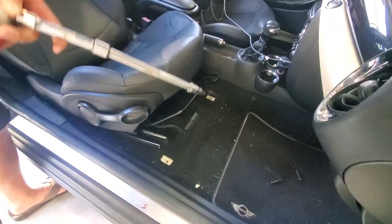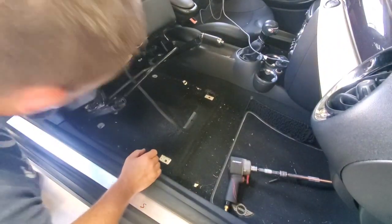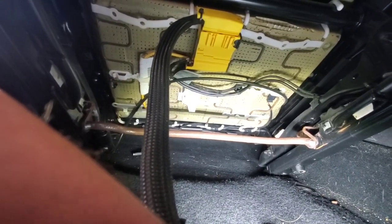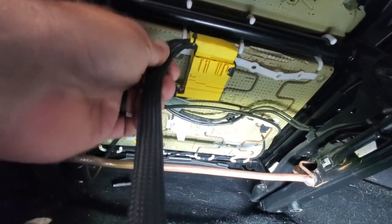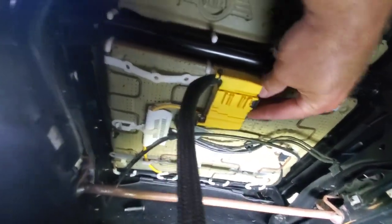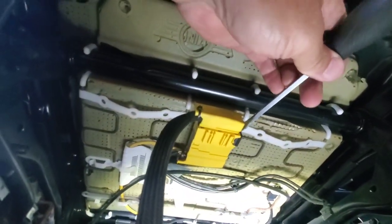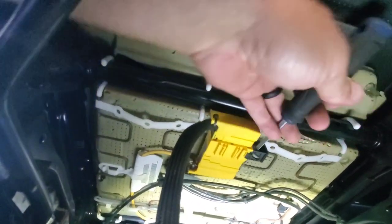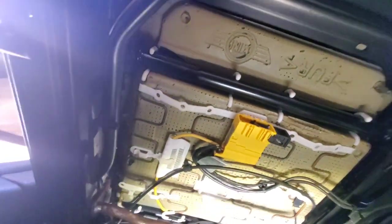Then I'm going to lay the seat back and look for the wiring. This is going to be difficult to film but I'm going to try to show you how to get the seat out. Basically just disconnect this one wire here and this yellow plug. This black fitting here will pull out with a flat screwdriver — it's got an open end, put a bit of screwdriver in there and it will pop out. Once you have that out as far as it'll go, the yellow plug will unplug, and now the seat is loose and you can pull it out of the car.